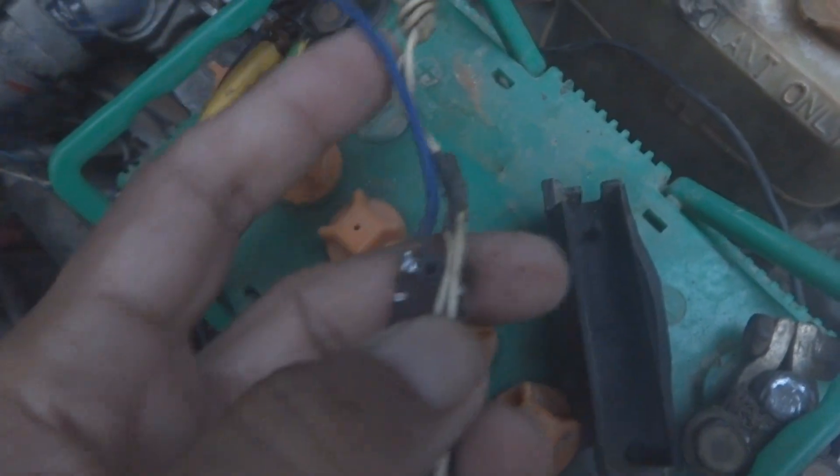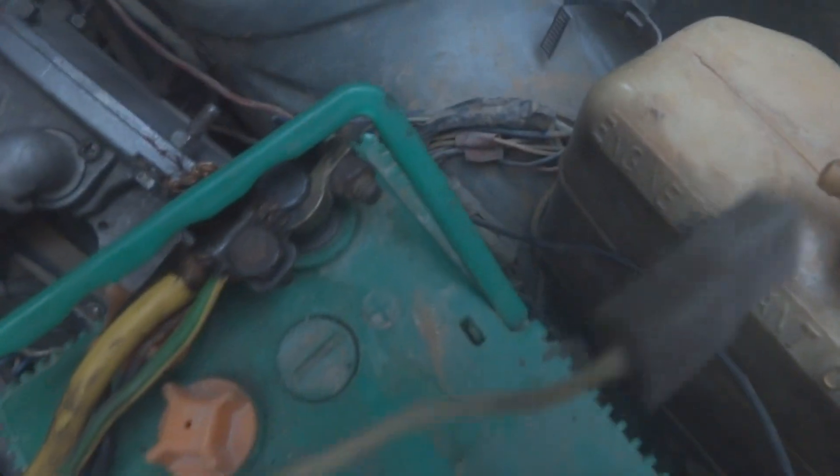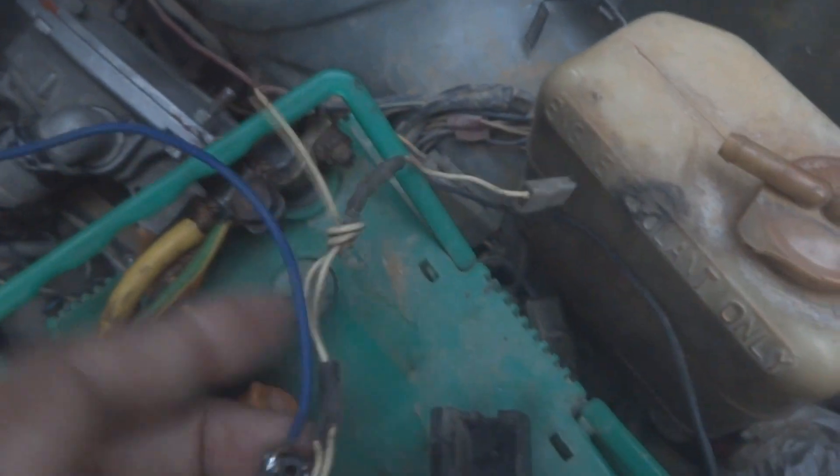Here is what this potentiometer is — it is important to understand. This potentiometer has three terminals. You can see these two wires here, and here is a third wire going to positive. This clip wire goes to the gauge unit, and this other wire goes to ground. I am going to show you a little diagram so you will understand it well.